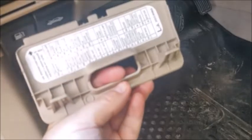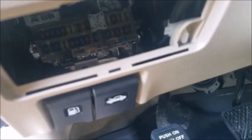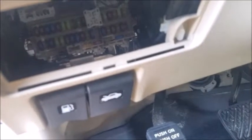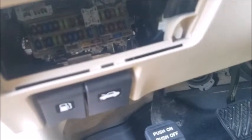This arrow here on the very left is telling me to point up. There are two lines of fuses — a top line and a bottom line. The very bottom line — you can see that these fuses are not vertical, they're horizontal. Those are spare fuses. So you can pull those out and use them. If you have a blown fuse, you can remove it and replace it with one of the horizontal spare fuses.